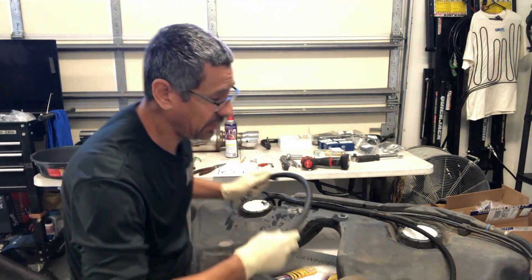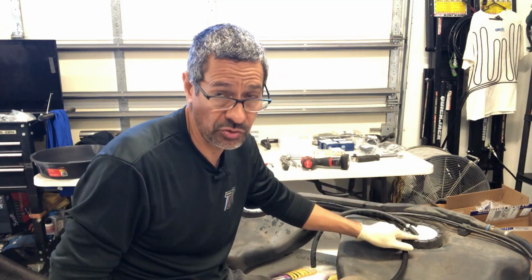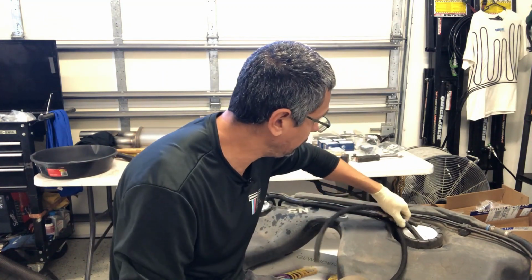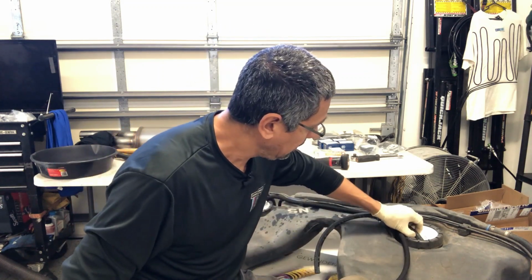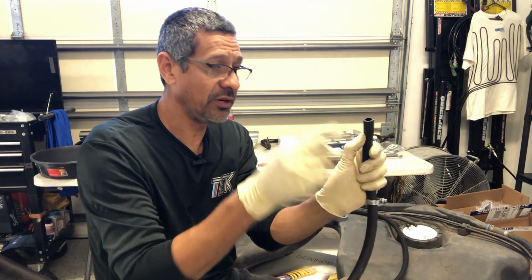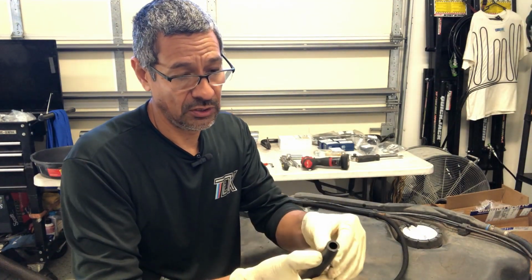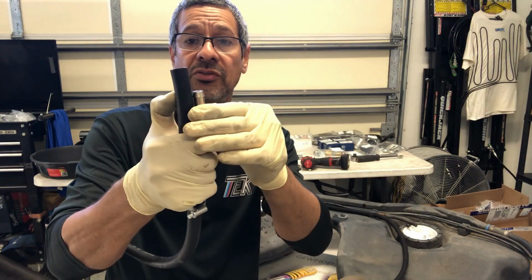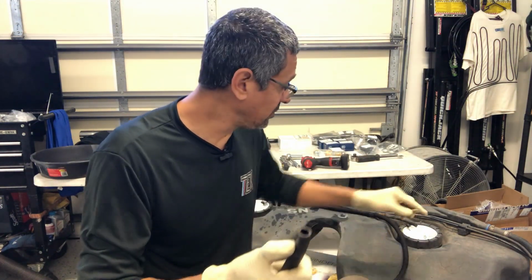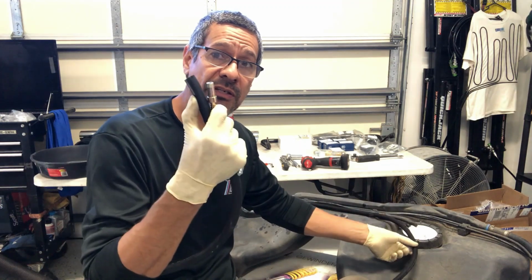All right, so now the next step is the 12mm hose. The 12mm hose is going to go into here, which is on the main pump, the return port for this pump. So what I'm going to do is fit it, and I'm trying to keep things a little bit clean. You have to keep in mind the reducers. This is going to be the reducer here. I'm going to try to have it almost butt up, with just a little bit of room. I don't want too much hose coming up, so I am going to give myself a little room. I'm going to cut this piece off just enough to where I can put this on there, and then I'll be able to trim the 8mm hose and attach it to here.